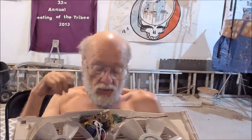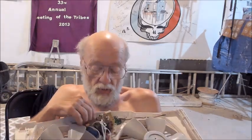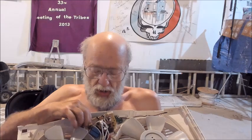Then I used the voltmeter to make sure I'm getting power to my cord, because power comes up and it's soldered to the back of this board, and the fuse, and so on. I measured 120 volts AC at this point and at the board. Alright, I've got a bad capacitor. I'm pretty sure of that. I don't see any trauma or evidence of any components burning. The resistor, that big one right here, is in the power circuit, of course, because it's huge. Same way as that capacitor I showed you, the great big can that's bulged out at the top.